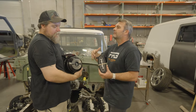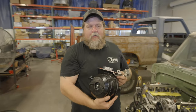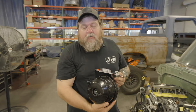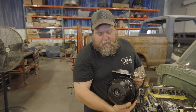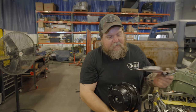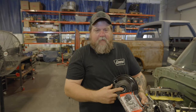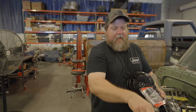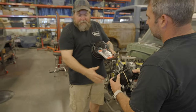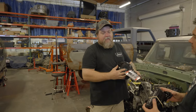Brett, why is that gap important? We get a lot of questions: my brake pedal's too low, it's real spongy, I have really poor brakes. Usually the first question is: did you measure the pin on the master cylinder for the booster? What happens is when you hit the brake, this pin is supposed to come and hit the plunger, which moves the pistons, which moves the fluid to the brakes. If it's not on the plunger, it's not moving any fluid.